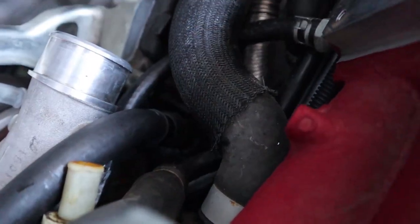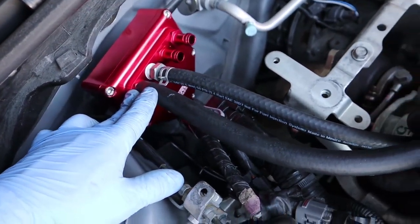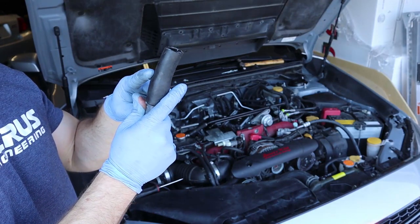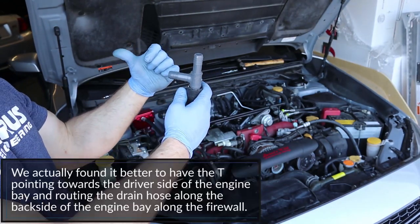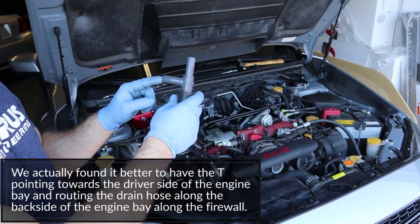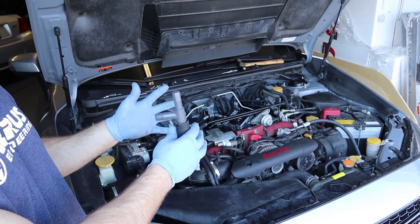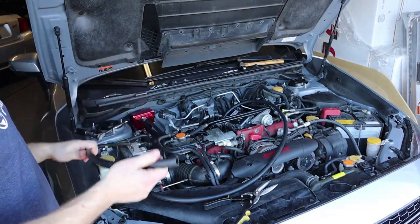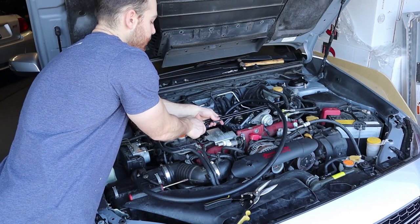If you are not running the drain back, there's a three-quarter to half inch adapter tucked away and that hose goes to the left side port on the AOS. Now we're doing the drain back kit: remove the OEM three-quarter inch hose, install our four-inch three-quarter inch hose, slide that onto the engine. This port faces the passenger side and that's the drain location. The top port is what we covered for the non-drain-back configuration. Grab your 18-inch half inch hose — from the head PCV port to the inner one — snake it through and install.